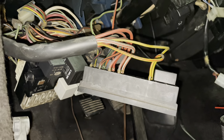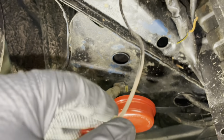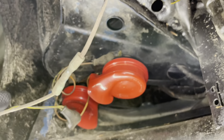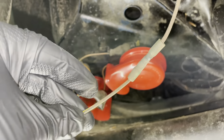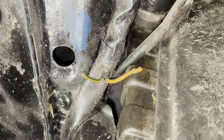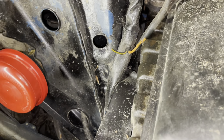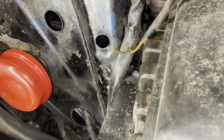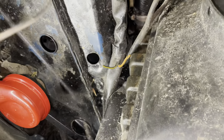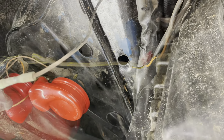I've made a discovery. This is the brown wire that runs into the car underneath the dash, and as you can see, it is actually a black and yellow wire. My theory is that when a previous owner broke the steering wheel, they basically just cut the wires and hooked it up that way. So I'm going to clean that wire up, put a connector on it, and see if I can get this horn to work. I've connected the yellow wire to the yellow wire — I am cautiously optimistic.